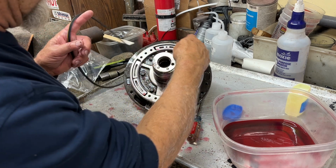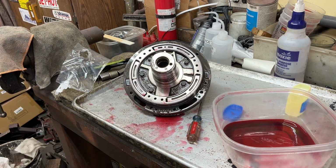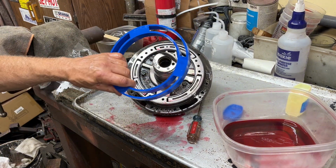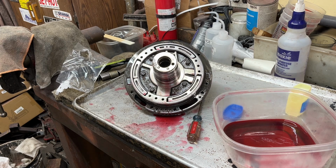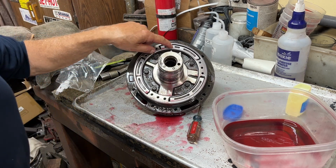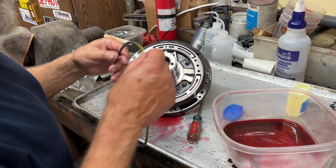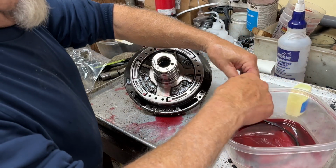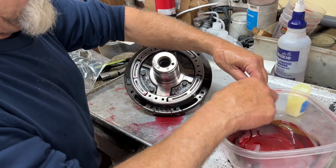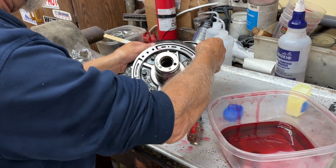Okay, I thought I could push that piston in by hand, but I couldn't. I had to get the piston installer plastic thing to do it. It's in there correctly now. This hole needs to be opposite these 4 smaller holes at the bottom. Now I got to put on this new square cut seal that goes around the outside of the pump. That should be fairly easy. This fits in a groove.